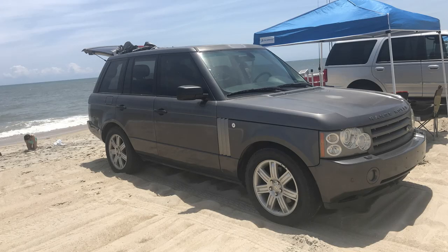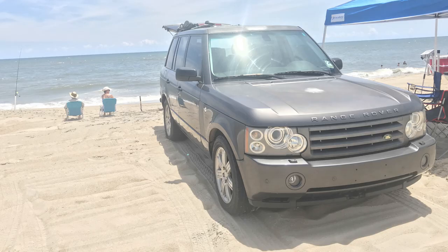What's up? My name is Rob the Car Guy and this is my Land Rover 2006 L322. A couple of weeks ago, I went to go start this thing up for the first time in a few months because we just got back from the beach here in North Carolina. We were doing some sand driving, camping out on the beach, fishing — it was awesome. But I went to go start it up a couple weeks ago and nothing. Turn the key, the key will not turn, the truck will not start. I have got the infamous steering column module failure.